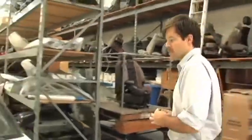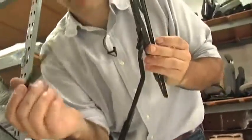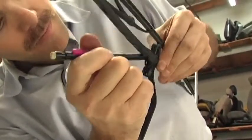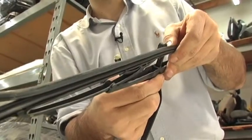Another common type of blade doesn't have quite as easy a tab to press. So you can take a pin, find the hole, push the tab, and release it in the same way. Push it down away from the hook, slide the rubber off to the side, and work it over.